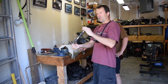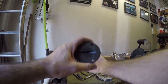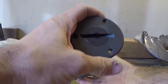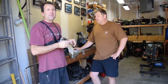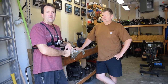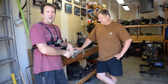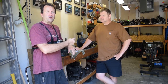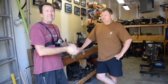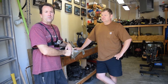This is an Engel FK7. If I remember correctly, the FK7 is pretty equal to the other one Engel has, the Engel 110 cam. The difference is this will use ratio rockers, and the Engel 110, I think, is designed to use stock rockers.